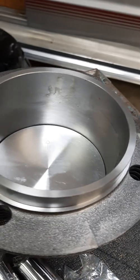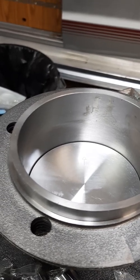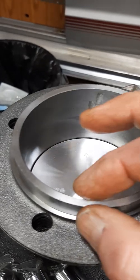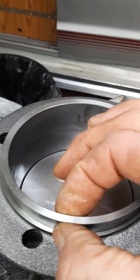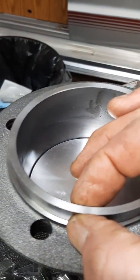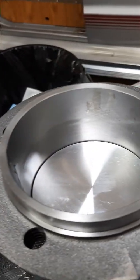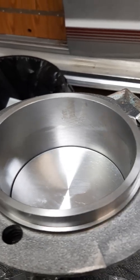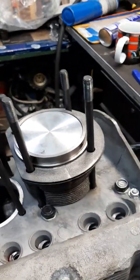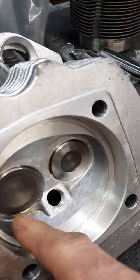It's a really nice build for a turbo engine — one of my other ones was a 1680 with a turbo and thick walls, and it lasted; it was a strong little motor. Having the really thick flange provides better sealing capacity with no head gaskets. I'm doing an 1835 turbo right now and I've had some compression leak problems at the head. I tried copper head gaskets and still wasn't successful, so I ended up redecking the barrels and redecking the combustion chambers again, and had to do some shimming to get my volumes and compression ratio right because it was compromised from the machining. There are a lot of things to consider when establishing deck height, which determines your clearance, and then the volume you cut into the head to decide your compression ratio.